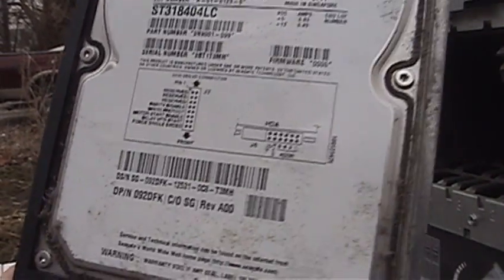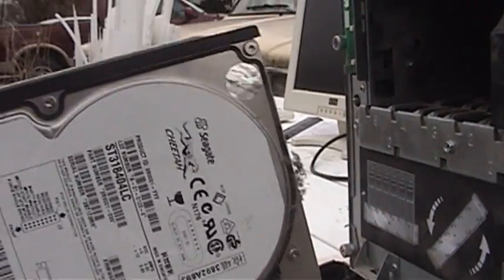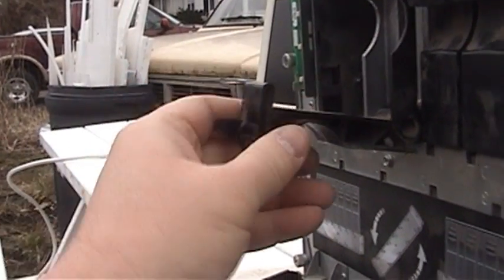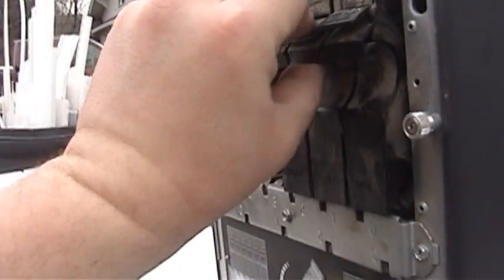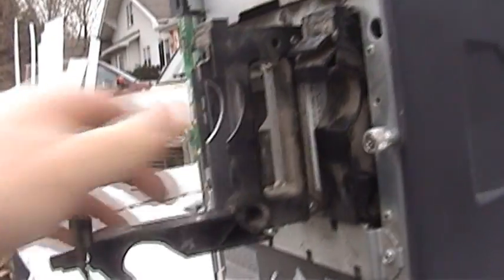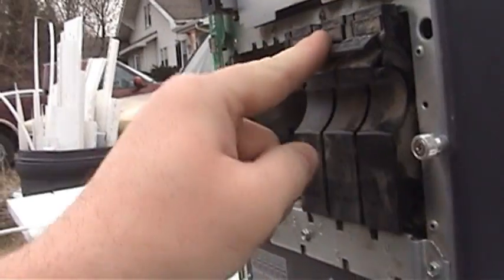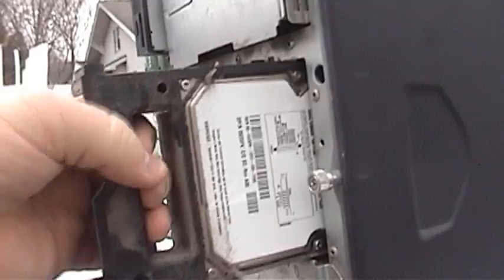You can see how they are configured, because again, this being a server environment, you might want to configure your drives so that they don't all try to start up at once if you have a lot of them, which could overwhelm the system's power supply, even a very well built system such as this. These drives are hot swappable. I don't know what kind of disk configuration this machine has, but with 3 drives it could be anything. Could be RAID 0, could be just a bunch of disks, a striping environment such as that. Could be RAID 5 with a parity volume, or RAID 1 with a hot spare. Probably more possibilities than that.